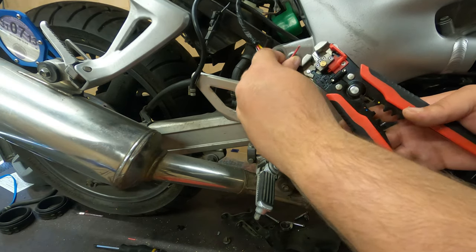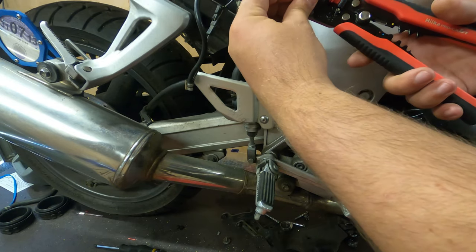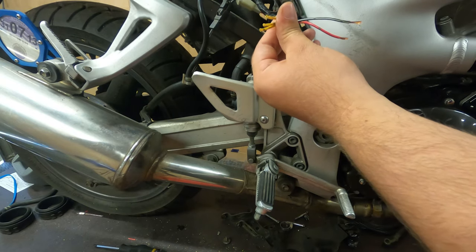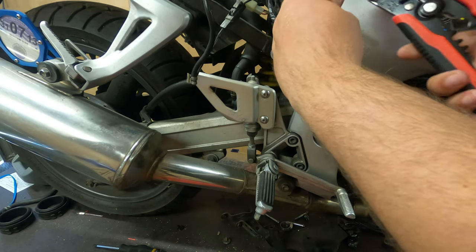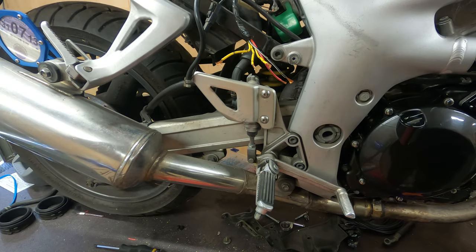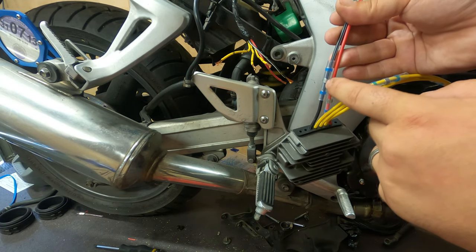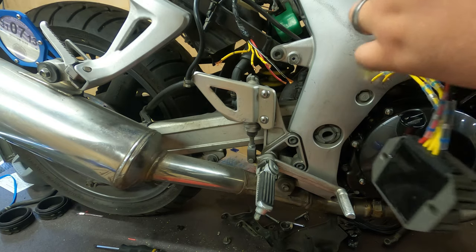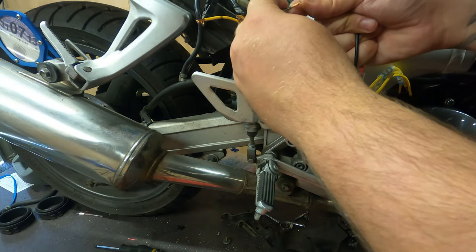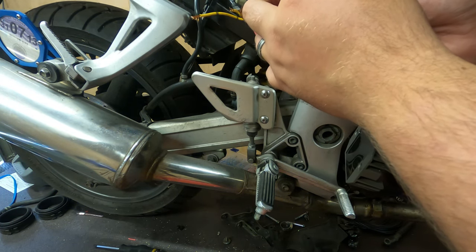So we just want to strip these cables off. With the yellow wires, the reason they're all yellow is because it doesn't matter what order they go in for the regulator rectifier. We're probably going to use the same as what we did in the last video, which is these heat shrink wraps with the solder in the centre. I'll put the link down in the description for those. All we want to do is simply splice two cables together — it's like having a solder and heat shrink join in one.